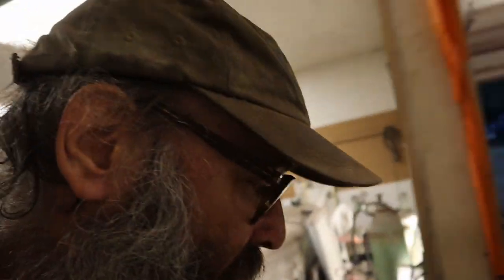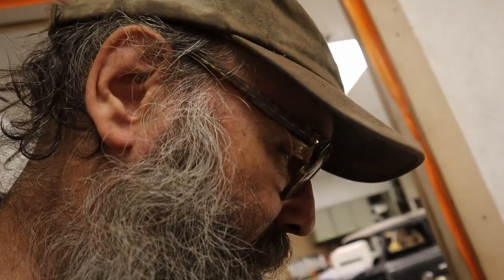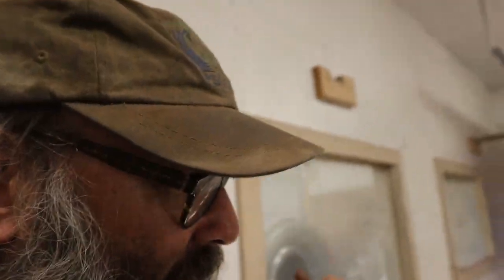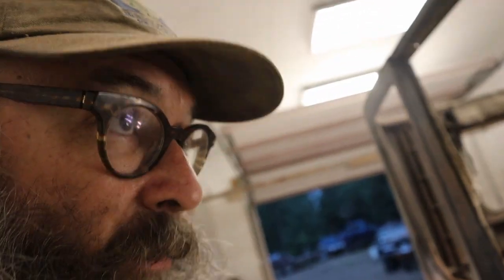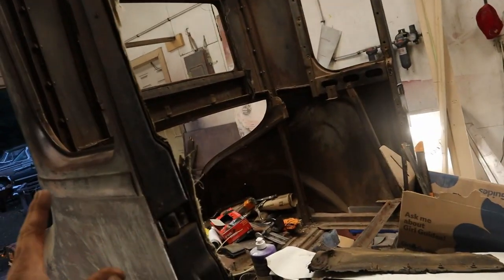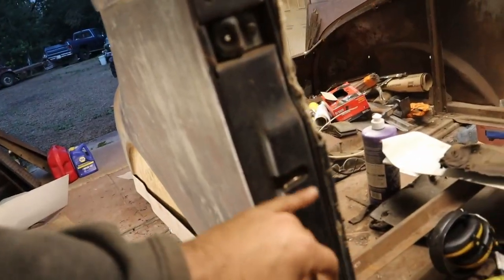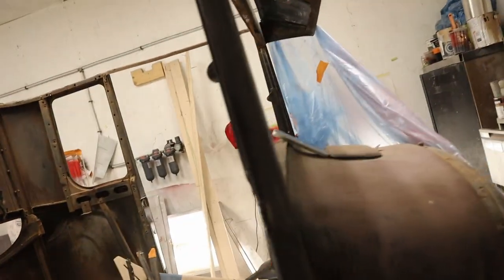This is the passenger side front door. It's in beautiful condition. It was quite saggy, and when you pushed the trigger, it would pop open about 30 degrees, and the middle hinge is actually broken off from the stress of being so out of alignment. Anyhow, it still opened and closed, mostly thanks to the little guide here that would help hold it up. Nevertheless, overall, excellent. Two bent hinges. One broken one.